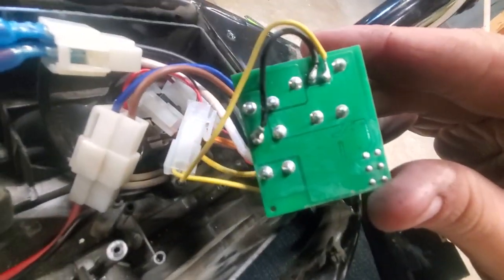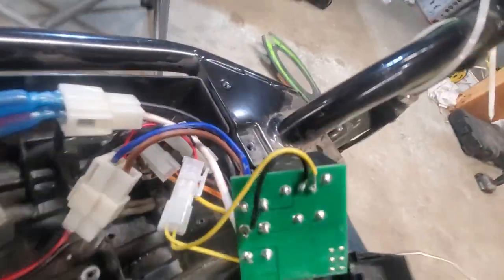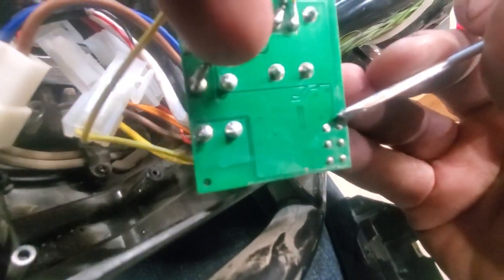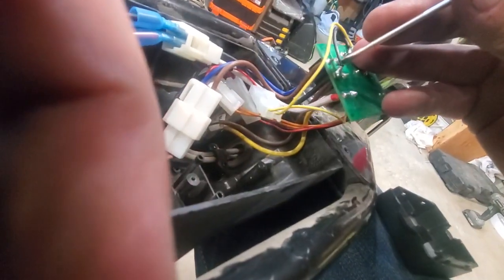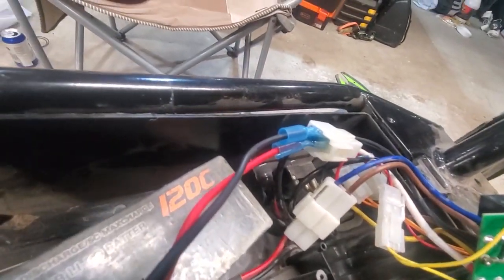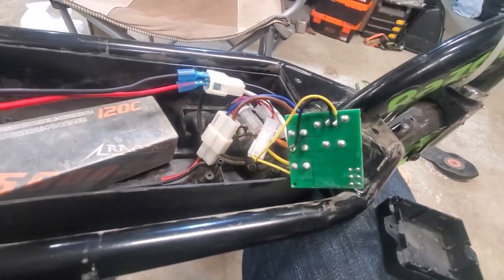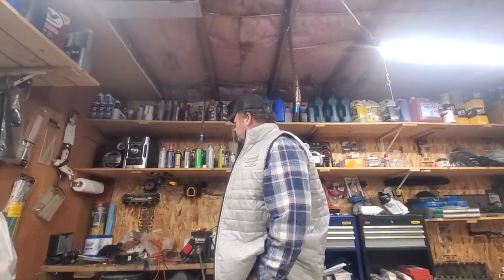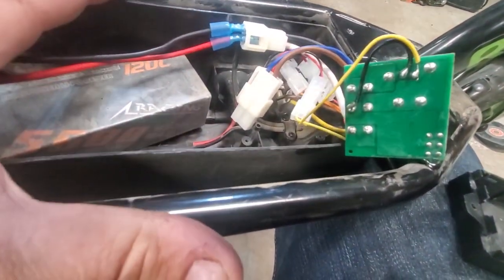Anyway, quick video on how to hotwire. If you want to screenshot this or take a look — on this model you've got to cut this one and solder it to there. As you can see, we did the yellow there, and then take ground straight from the battery and solder it to the other pin. Now you've bypassed everything and it works on a switch. Interesting deal — probably not too many people that want to do this, but for those that do, here you have it. Hope this video helps somebody. As always, may God bless you — and credit to my great dad there for not being photogenic, the one that made all this possible because I would have been clueless. Take care, guys.